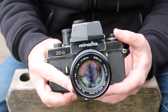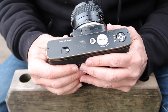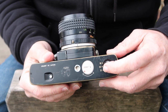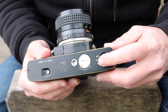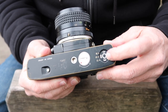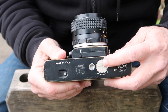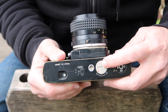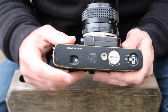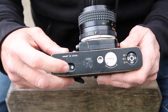I think they work every bit as well as the Nikkor lenses. On the bottom of the camera there's a selector switch which allows you to select and display the number of exposures of film you have, and also the kind of film — whether it's color, slide film, negative film, black and white, or whatever. This is the battery chamber — you can use a couple of SR44 batteries. And this is the release lever which releases the winding mechanism so you can rewind the film.